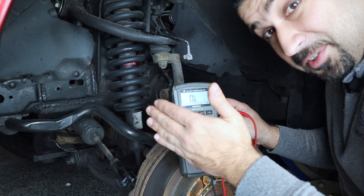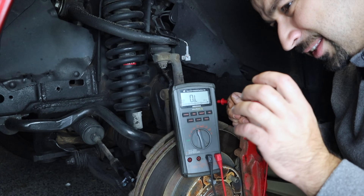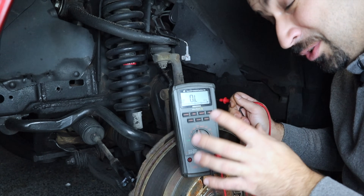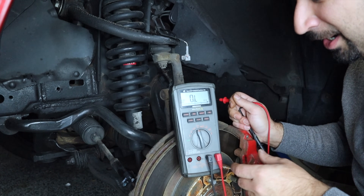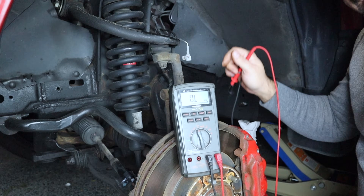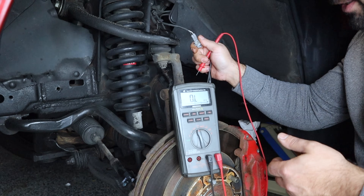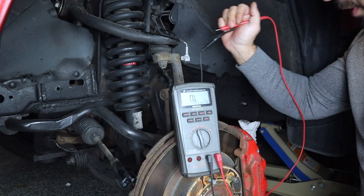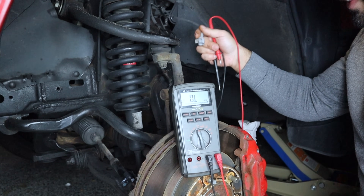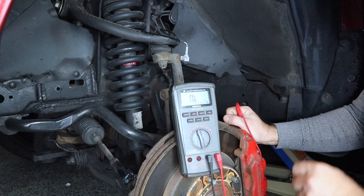If you're a DIYer, go to the other side and test that sensor. I want you to remove the sensor — sometimes these sensors will read differently depending on whether the magnet is in front of them or not, but we'll talk about removing the sensor. Compare it to the other side: do a quick resistance check on this side, a quick resistance check on the other side, and you'll establish a known good value. If you have OL, this wire is potentially open and you just need a sensor wire. In this 4Runner they're fortunately separate.